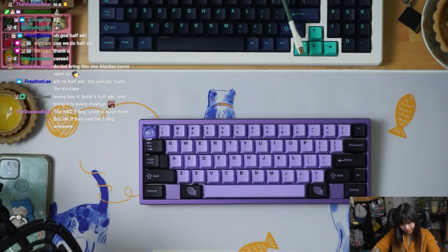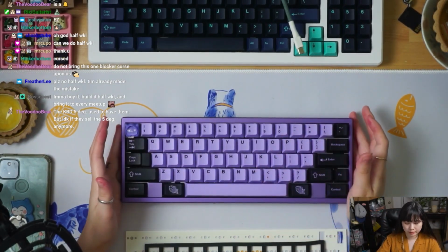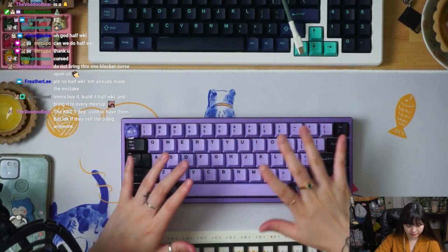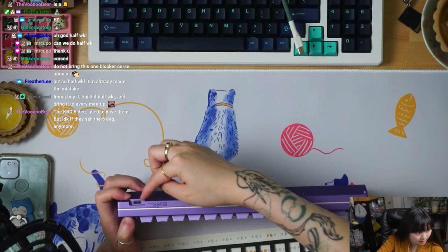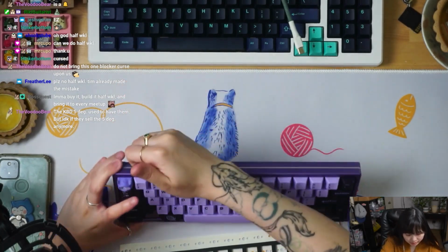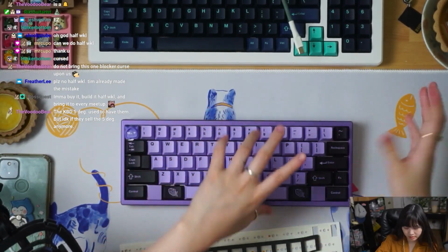So if you're watching this and you're trying to assemble your Isabell, but you're really confused and not sure if you're doing this correctly, I will say that what Father said earlier about how to assemble the case is putting the bottom case, the mid piece, and then the plate, and then the top case to align everything. When you're putting in the plate or the PCB, make sure it slides in and aligns with this hole, then adjust it, and then you can put it on top. After everything is aligned, you can flip it over.